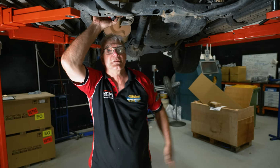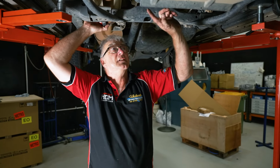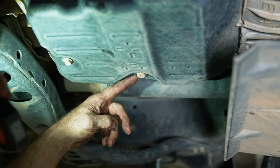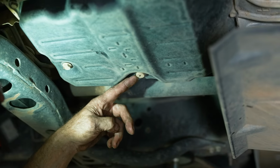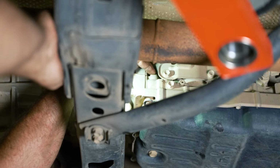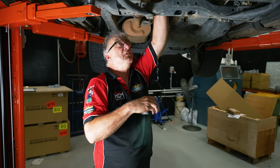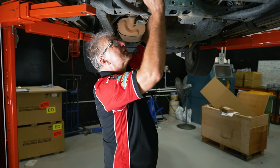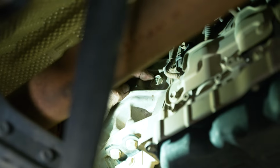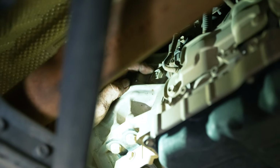Okay, the last thing we do is the filling process, which is pretty easy. The AC60s also have a check plug here for the level. Our filler is actually up here, which is a Torx bit plug, which points down. They can be a pig to get to. The easier way to do it is using a 24 mil spanner or socket if you like, and undo this plug here, and it's nice and easy to get a hose in there and fill it up through there.